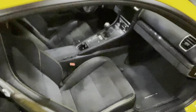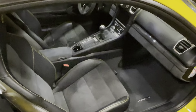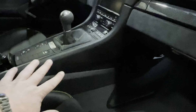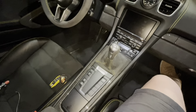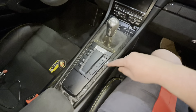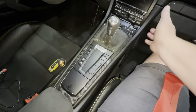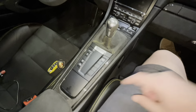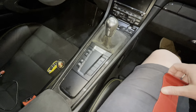Welcome to the inside of my GT4. What we need to do is take off this trim piece here. If all is well, this is just a press fit. We should start at the back and pry it loose all the way to the front, then pull it straight forward. That should get us to the screws we need.